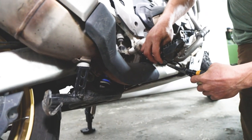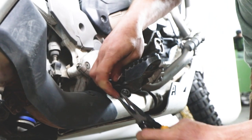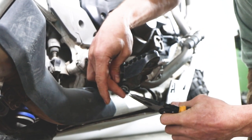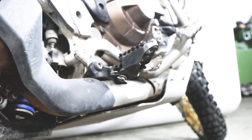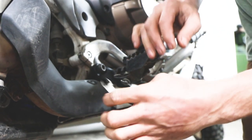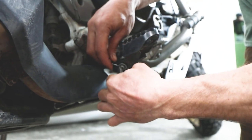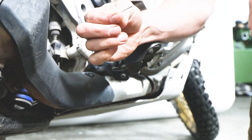Let's go to the underside of the foot peg body — you're going to want to orient your cotter pin, flatten it out, and drive your cotter pin. There's a trick with the cotter pins using a pair of side cutters: you can leverage into the soft steel of the cotter pin and actually pull it through, because it's always going to be bent just a little bit and won't come right out.